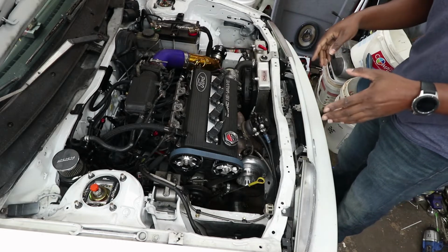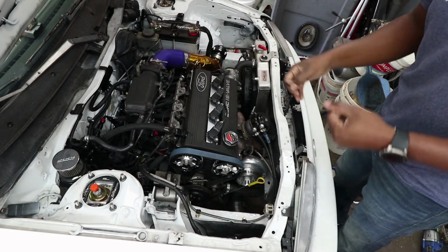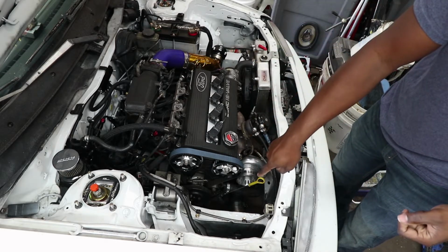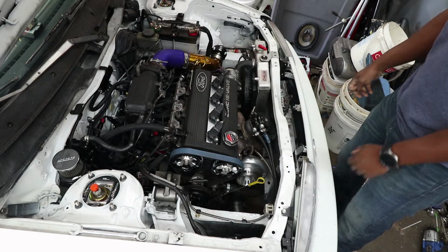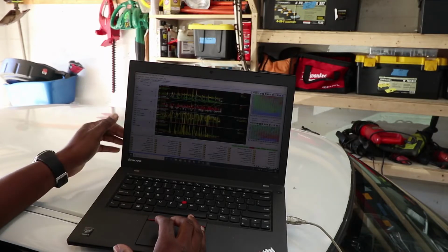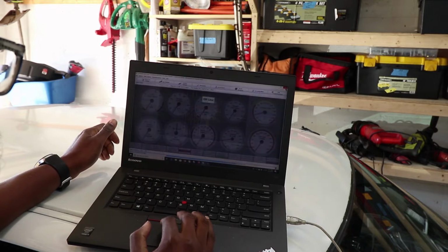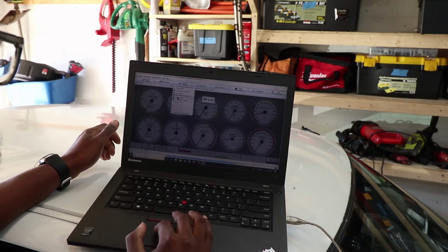Anyway, so what I'm going to do is go into the software. I'm going to set the Megasquirt to 10 degrees base timing. It'll hold it steady at 10 degrees, and then that way I can check the timing mark on the end of the crank there. You might be able to see that, you might not. I don't know. So, maybe close that. Go into ignition settings.